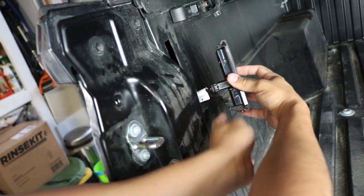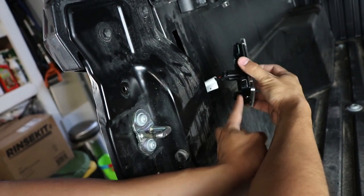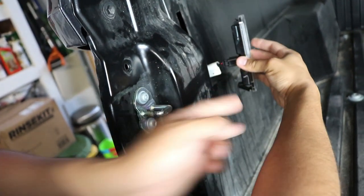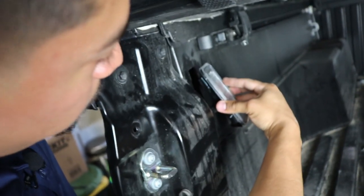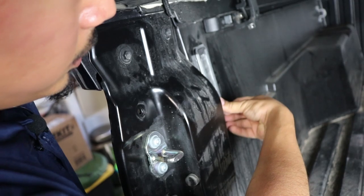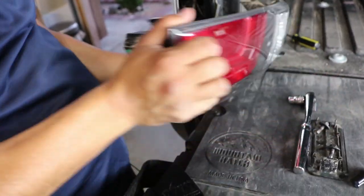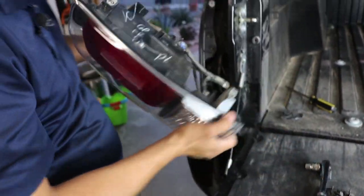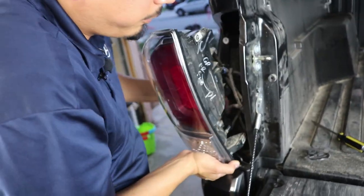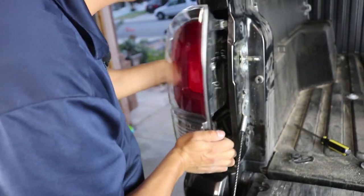Now focus back where the light goes. Make sure to put it in the right direction — the two little legs are facing up and the plastic clip is on the bottom side. First put the top in, then pop the bottom in. Now go ahead and reassemble — put the taillight back together — and then we'll do the same thing for the opposite side and test it out so you can see how bright they really are.